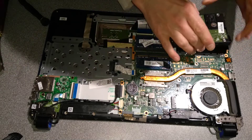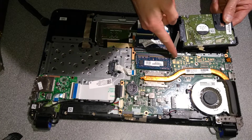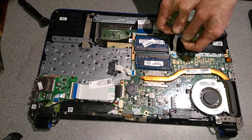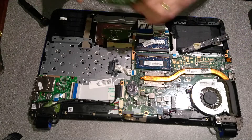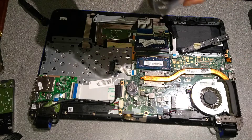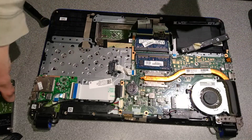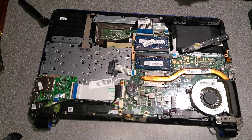That's now removed upwards. Be careful when moving this around - you've got this really thin hard disk lead here. Being careful not to damage that cable, undo the serial ATA connector out of the back of this hard disk. There we go - that's the hard disk undone. I'm going to get the SSD that I'm going to put into it, and then we just do the reverse. I'm going to clone this drive onto this drive first so that we don't have to reinstall Windows. This video will carry on once I've done that.